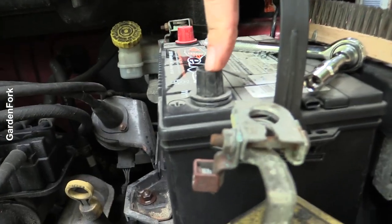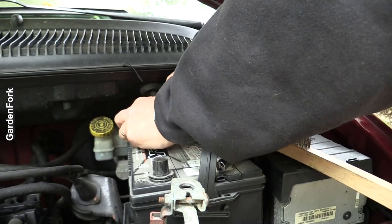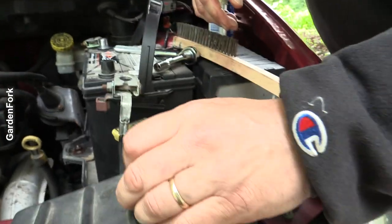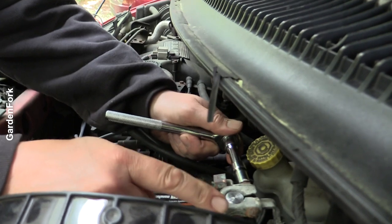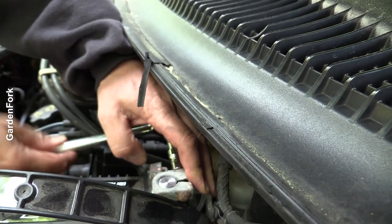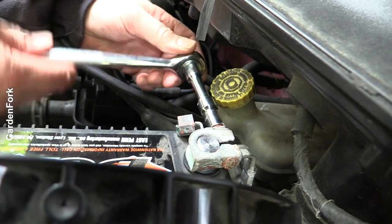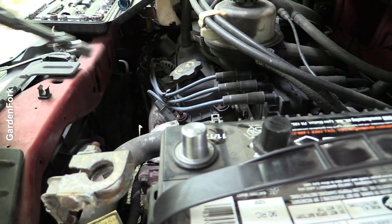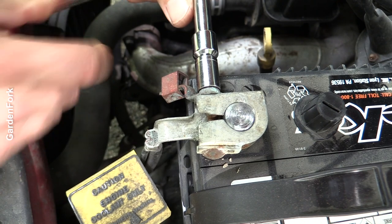It's really nice having the camera operator have laryngitis — I can just talk and talk. Black is negative or ground in a car; red is hot or positive. We're going to hook up the positive one first — the red one. Take care not to break the battery terminal post off; it's hard to do, but don't wrench it with a giant impact wrench. You want it tight — you want good contact between the battery terminal and the battery cable. Now we're going to do the black terminal, the negative terminal.